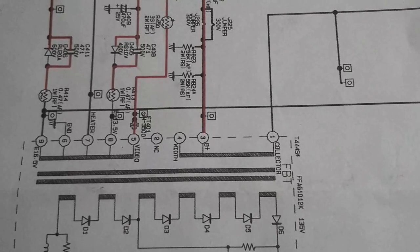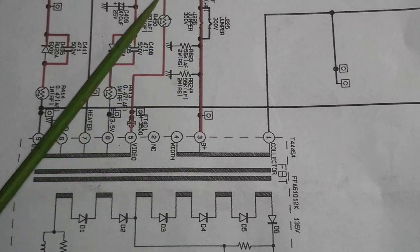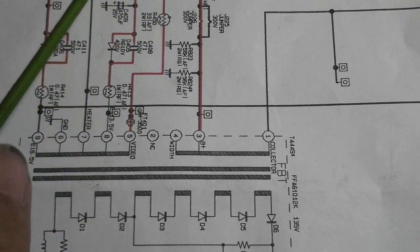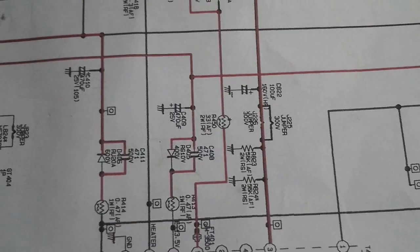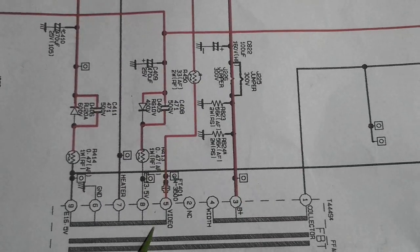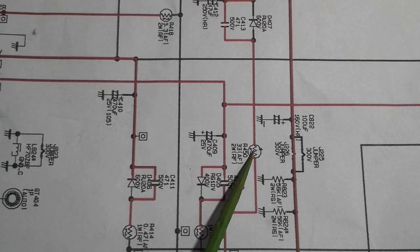When I turned off the TV, I noticed a small dot on the screen. I turned it back on to show you — when you unplug it, a luminous dot appears on the screen. For this type of defect — dark screen — we generally go to the output voltage that feeds the video. Here, the RGB voltage of 200 volts comes from pin 5 of the flyback. We need to test this voltage.